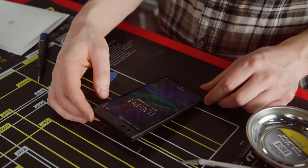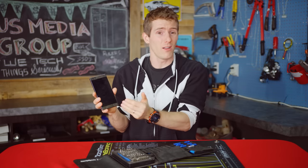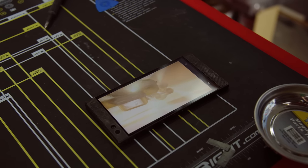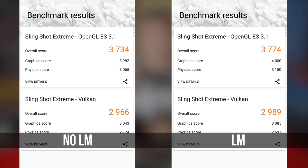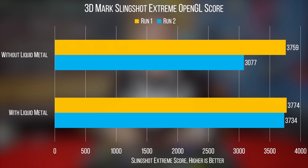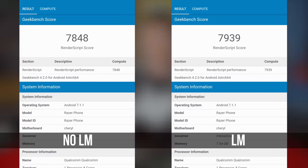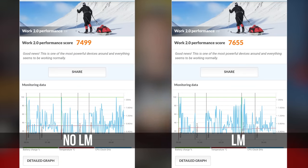Hitting the power button — it boots. Now it's time for the payoff, or lack thereof. We weren't sure, given that we hadn't liquid metaled all the way to the chip itself, if this was even really going to work. In 3DMark we immediately recorded our highest result yet, but not by a very significant margin — cautious optimism at best. Then on the second run — whoa — no decrease in performance whatsoever. In the Vulcan test, which comes after the OpenGL one, we went from very middle-of-the-road performance compared to other Razer phones to being in the top 4%. Our other benchmarks saw modest gains too. This phone has ugly grills, but you could game on it indefinitely and see virtually no drop in performance — an A-plus result.